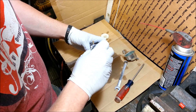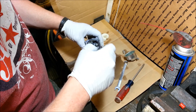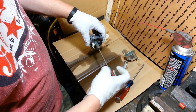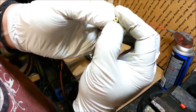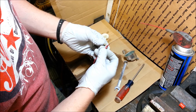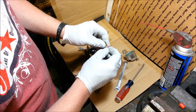You've got your main jet up in here — we're going to remove that. Make sure you have a really good screwdriver, something with a really good brand new tip. Once you strip it, there's nothing you can do about it. We're going to pull out our main jet, and all it is is a little tiny hole. I can tell there's a little bit of green corrosion on it, so I'm going to spray it out with carburetor cleaner but also use copper wire. I don't like steel wire or wire from a metal brush because it'll scratch the soft brass and enlarge the hole. Copper is soft — copper won't. So I'm going to take a stranded copper wire. If it's bent and wavy, that's even better, because that kind of goes in there and rubs all the sides. I'm just going to make sure that thing's clear.